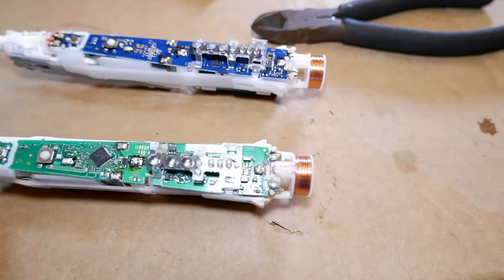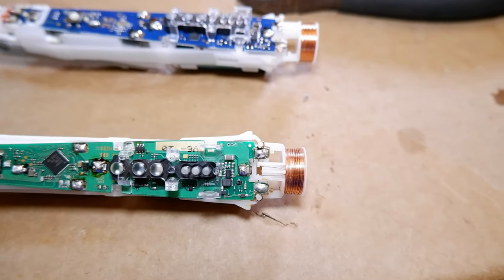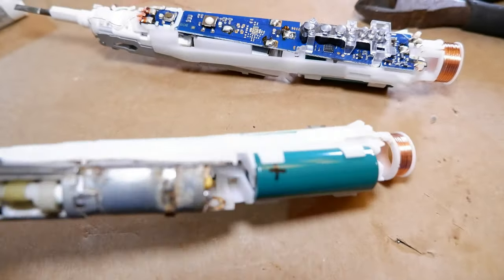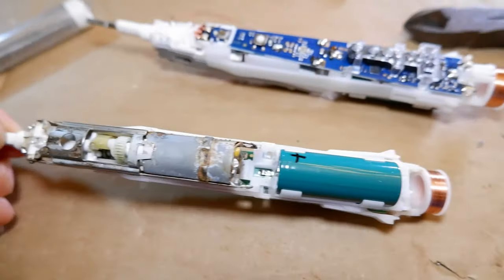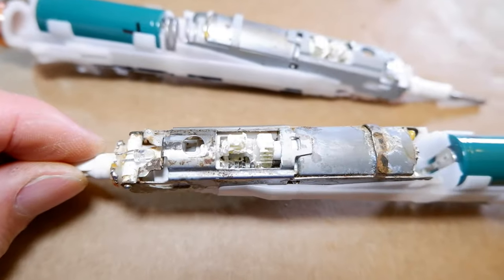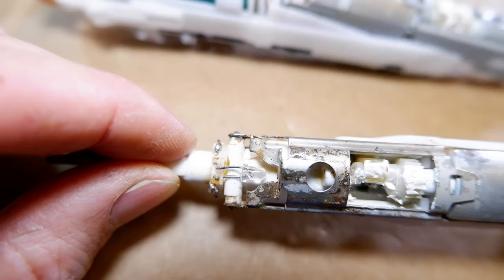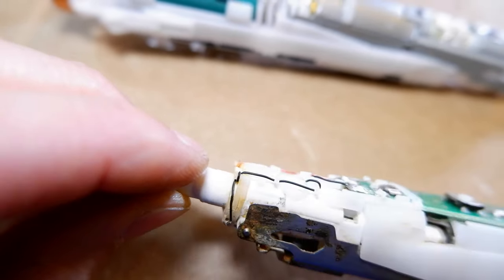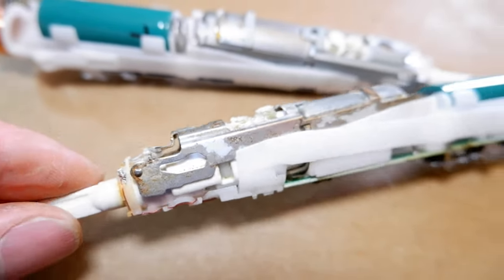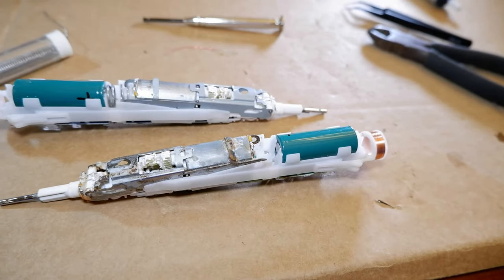Got this baby all cleaned up — all the solder joints are nice and clean. I re-hit a lot of the bigger solder joints just to make sure none of them corroded away and they all make good contact. The battery is tucked in nicely with the lead through the hole. I replaced the LED and reused one wire while replacing the other that was too corroded. I put a little dab of white lithium grease into the gear motor on both toothbrushes using a screwdriver to work it into the gears.